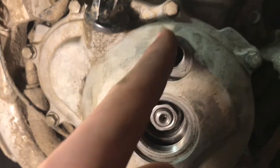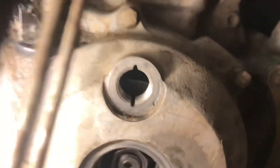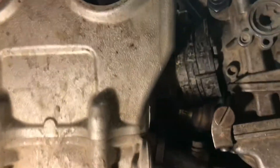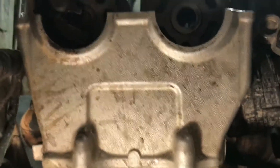You want to line up that 'I' with the top notch right here — that's your timing mark. That little mark right there, you want it lined up with this, which it is now. We're lined up up here and on this side also, so we are in time.